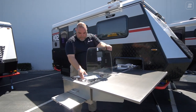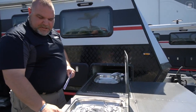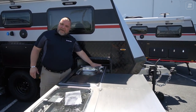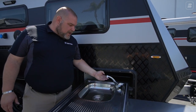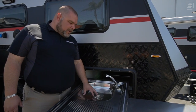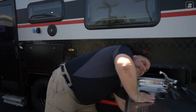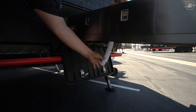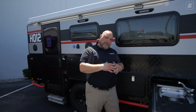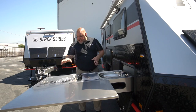We have a dramatic three-burner stove — one, two, three burners. This is an electric start that works off the batteries in the unit. You push to get the fuel to flow. We also have our sink area — the faucet is in the down position so it doesn't interfere, and it raises up to whatever position you need. This is a gravity drain: run your water, place a bucket under the white drain hose underneath, catch your gray water, and dispose of it appropriately.